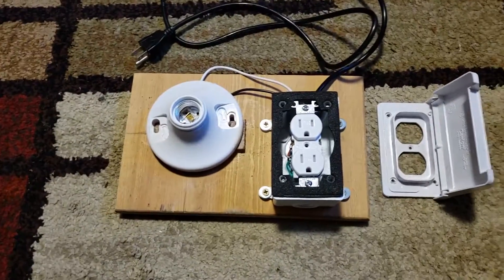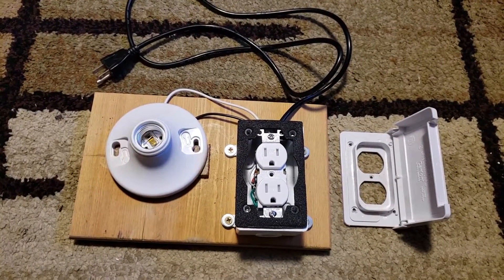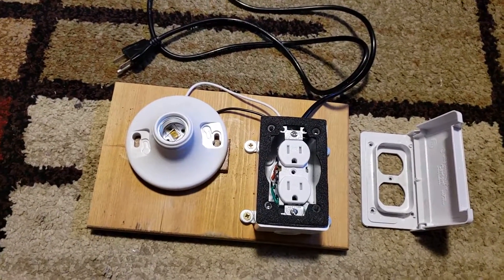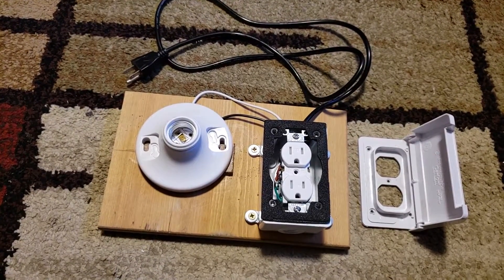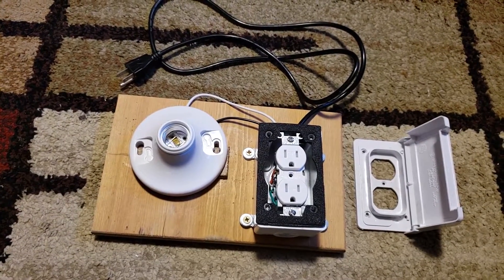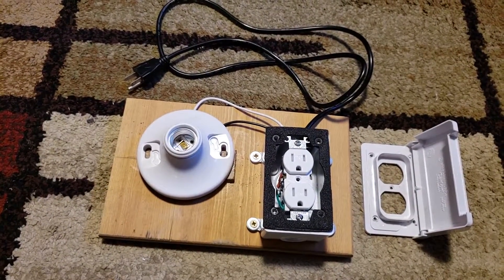This is, I'm told, one of the best tools for that job. When you plug it in, you have a bulb here that's rated to about 50% more capacity than the device that you're plugging in, and basically it takes the load if there's any short circuits or anything like that to prevent damage to your unit and your household system — tripping breakers and all that sort of stuff.